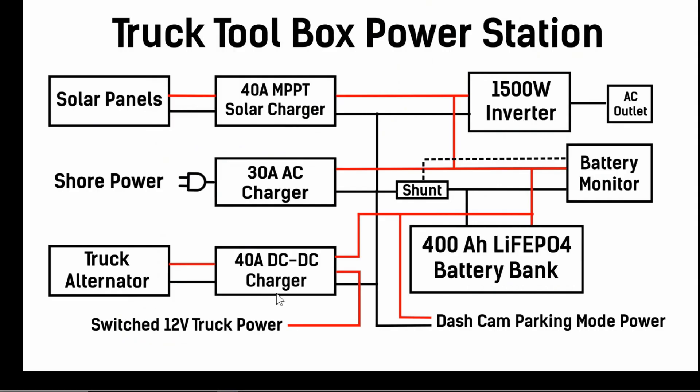There's the solar panels - I just have one 100-watt panel on the toolbox so it's always charging. Normally all I have coming out of this system is power for my dash cams. I have parking monitors that run 24/7 with about six or seven cameras monitoring around the truck, using about an amp or so. This 100 watt puts enough power back to keep everything equal. But I can add more panels because I have a 40-amp solar charger, so I could put about 500 or 600 watts of panels here as a ground array if needed.